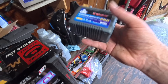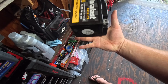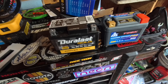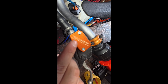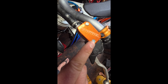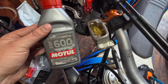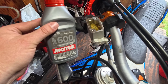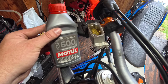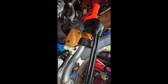Got a Tusk lithium battery for it. This thing is ridiculously light. The clutch and brake fluid reservoirs — this one's got the factory KTM Torx ones, this one's got a bolt and a Phillips. So we're going to change them all back out just so they match. I didn't record it but I put some fresh RBF 600 in it. I pulled it apart and it was pretty dark, so I bled the brake and it's got fresh fluid now. The clutch did look new and good, so I left it alone. I got them swapped out to black Phillips heads — I don't love them, so I'll probably switch them out to some stainless or get a couple more OEM ones eventually.